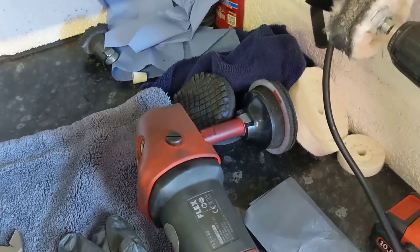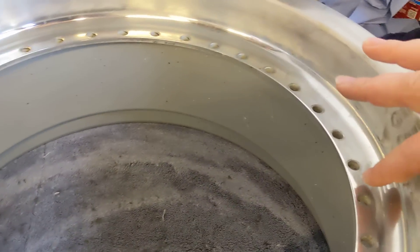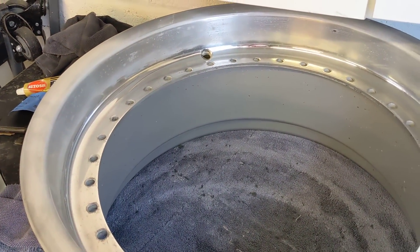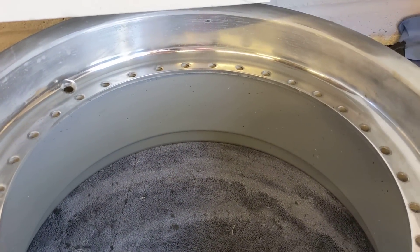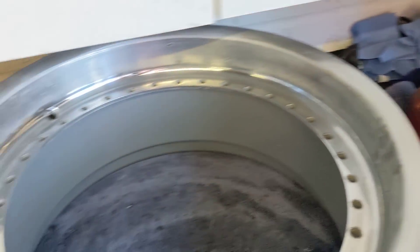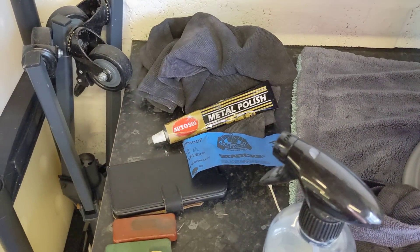Let's go and talk about the new car - can you guess what it is? My garage is a mess. I'm using the rotary, doing a bit of sanding on them first to dig out the really heavy etching. These are old wheels and I've got all these tools here. I'm finding that less polish with the foam pad is giving me the best finish. I go over them first with the wool pad because that seems to dig out most of the horrible finish. I'm finding Autosol is working better than some of the other metal polishes I've got.